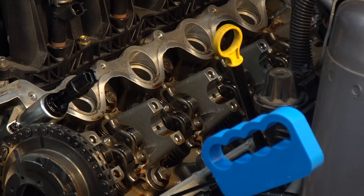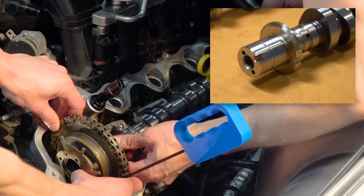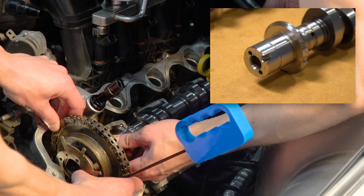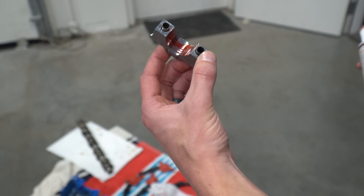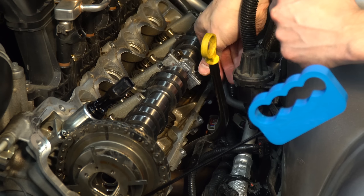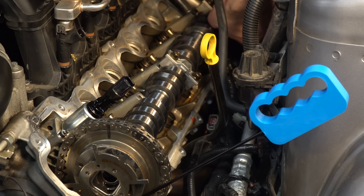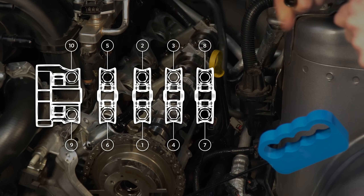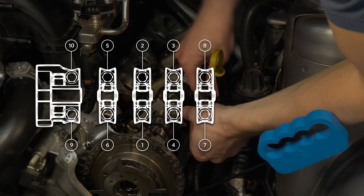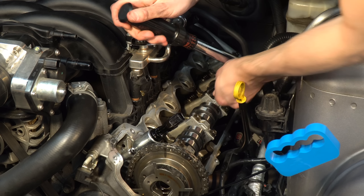Since Detroit Rockers don't require spring replacement, we're ready to install the new cam. Ensure none of the roller followers are out of position and carefully place the new cam. Align the notch on the nose of the cam with the pin inside the phaser. Clean the bearing caps with brake cleaner and generously lube the saddles. Reinstall the bearing caps in the same position and orientation they were removed. Do not torque any of the bolts all the way down yet — slowly tighten the bolts in the pattern shown so the cam is pushed down evenly onto the roller followers.